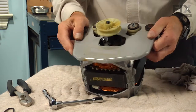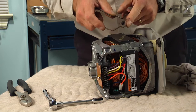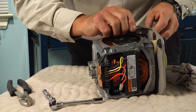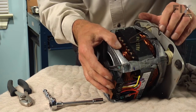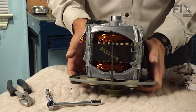Make sure that it pivots freely and then we're ready to reinstall the spring. Take the hook portion of the spring first, insert it through the opening in the top, rotate it around, and compress it enough until it snaps into both the notch on the motor base and the notch on top of the motor. Now we're ready to reinstall the motor assembly into the washer.